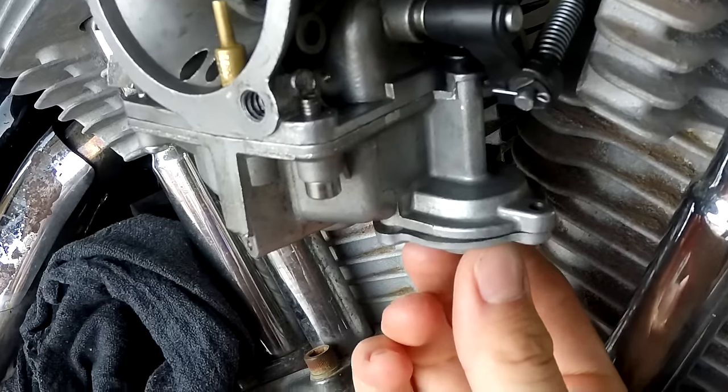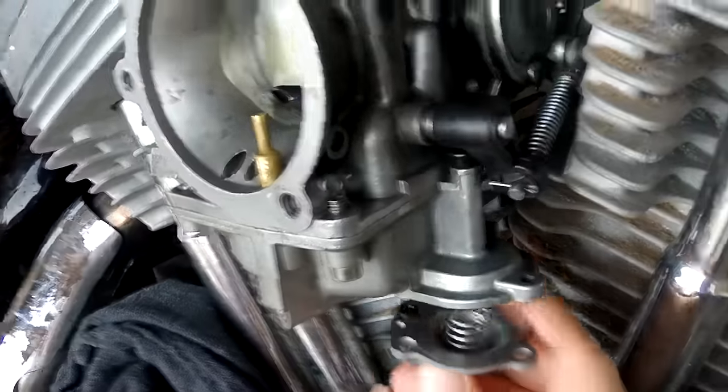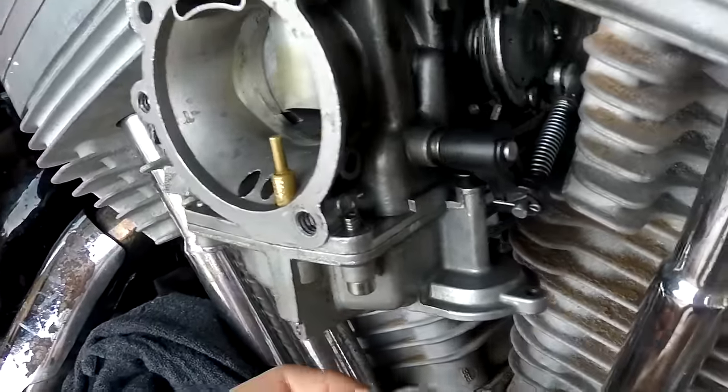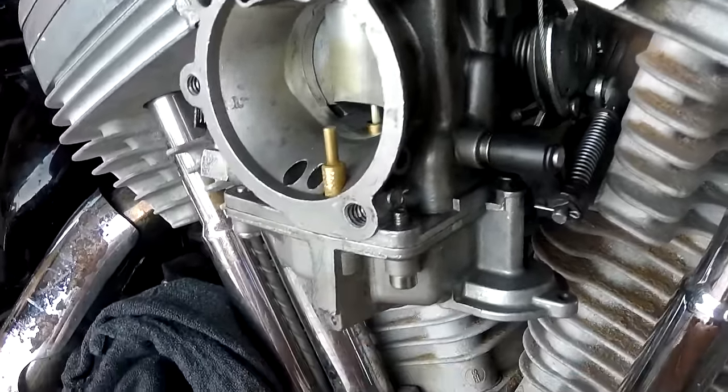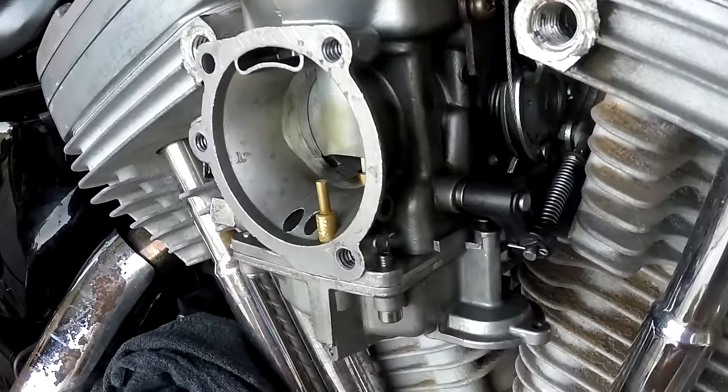You have this little plate at the bottom. It's three little screws — you pop it right off. You're going to have a little spring in there, so be careful not to lose that. Then you're going to have this diaphragm, and chances are it's going to be torn. I'm going to throw up a clip right now — I have a pretty good clip of the old one.